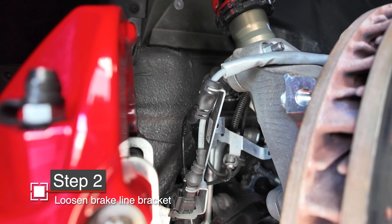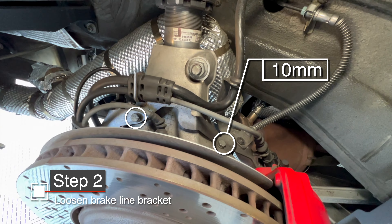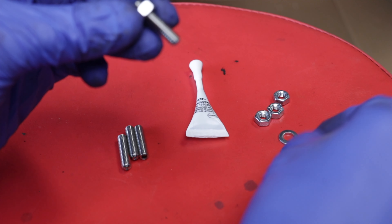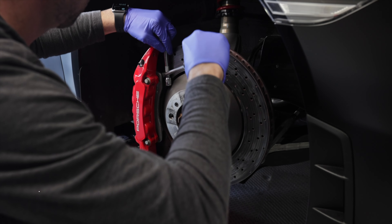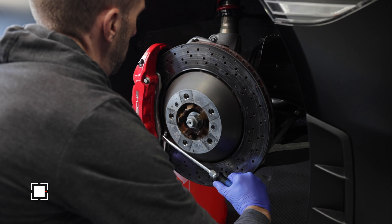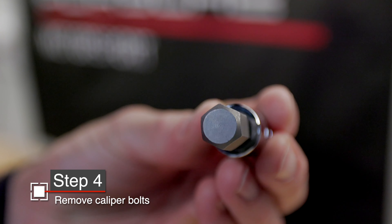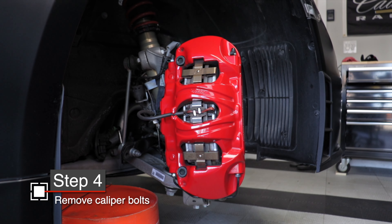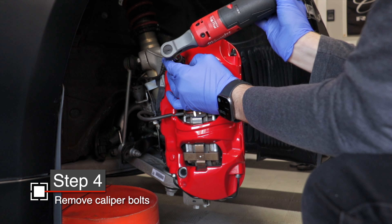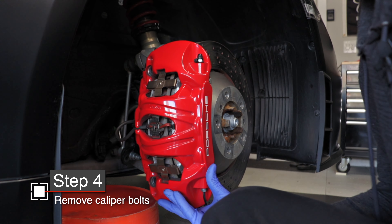You can see the loose bracket here. The rear also has 10mm bolts, but they're on the top section. It's those 10mm bolts that we're going to be replacing with the studs from the brake line kit. I'll use my method of gently prying back the pads — easiest way while it's still on the car. Next, remove your two 10mm internal hex or Allen key bolts that hold the caliper on. Once these bolts are out, the caliper is free to slide down, so be ready to catch it and set it on your bucket or hang it.